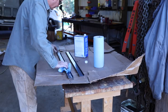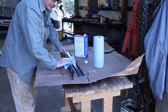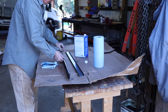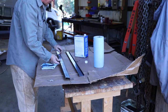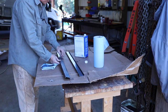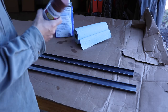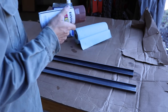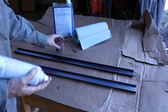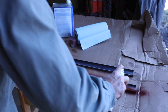I'll use a little bit of mineral spirits here because this steel is greasy from the steel yard — it's going to have a protective film of oil and goo on it that paint won't adhere to. A paint job is only as good as the prep. So once everything is nice and dry and super clean, we'll put the first coat of primer on. Ever wonder how long you should shake a rattle can? 60 seconds vigorously is typically enough to get everything mixed up.